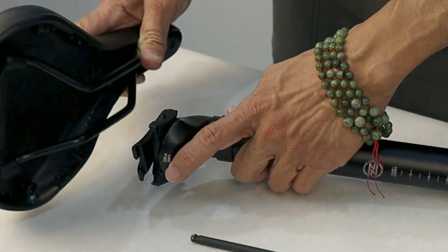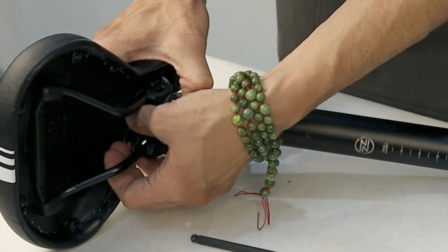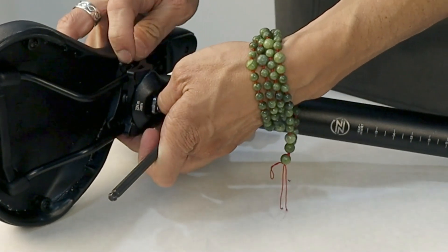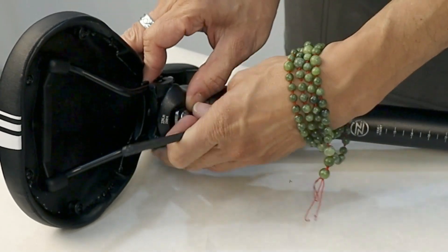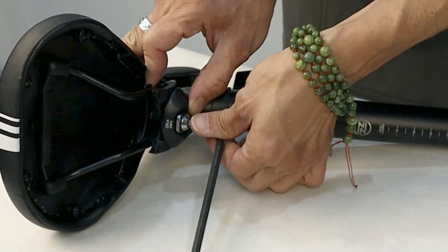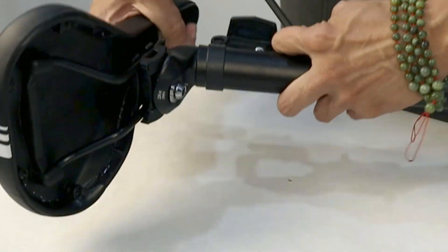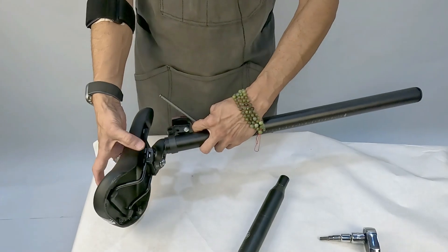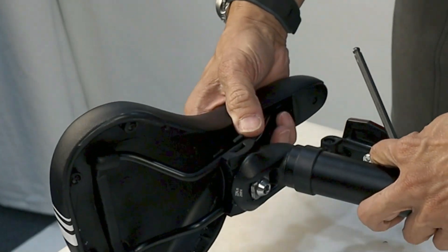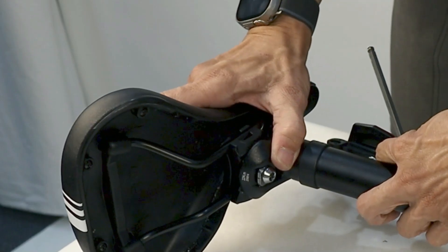Put whatever new saddle you want on there, working in the opposite direction. Taking that plate and flipping it backwards, then going the opposite direction — turning it right to tighten — making sure to hold that top plate in place. Don't worry about doing any adjustments right now; we just want to get it fixed so the saddle's not going to fall out. It's still relatively loose, but the saddle is in and secure. Here's where you can do your minor adjustment for aft position and angle adjustment. Once you've got everything where you want it, you just finish tightening it down — turn it to the right to tighten.